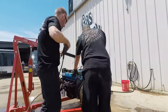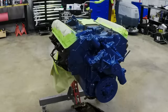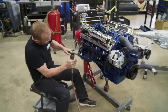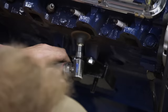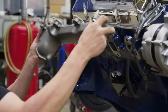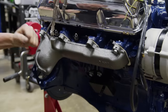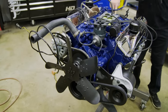That means cleaning it up, and after Mike paints it the proper Ford blue, I'll replace the damaged oil pan and button it up with all new gaskets and seals. Gaskets are found almost anywhere there's metal on metal, and their function is crucial to providing an airtight seal to avoid leaks of liquids and gases. There you go — that's what a 335 horsepower 428 V8 should look like. Nice and new.